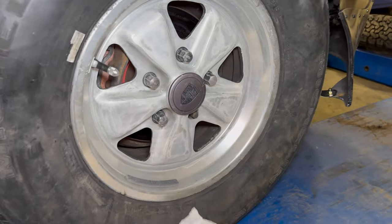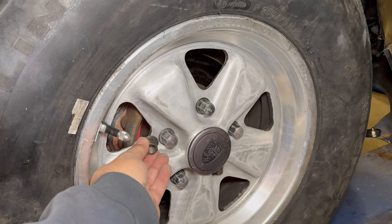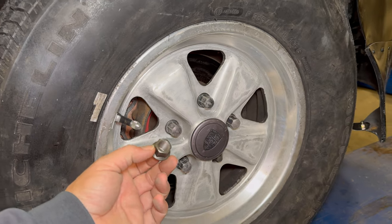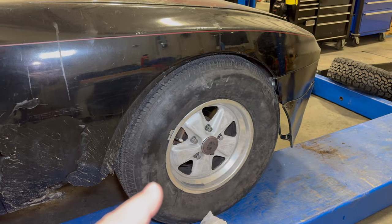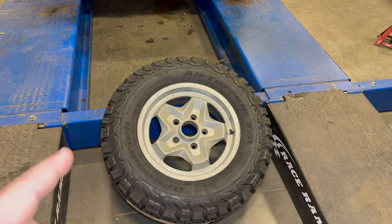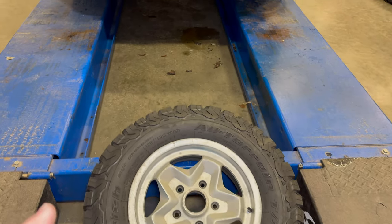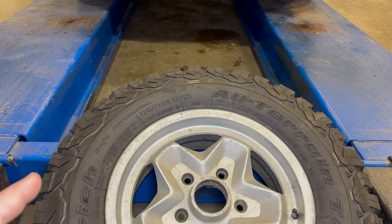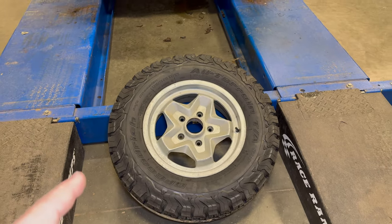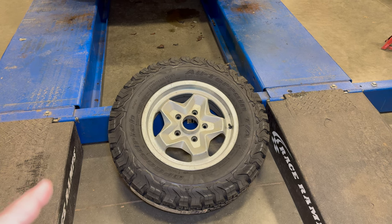So I did buy all new lug nuts. These lug nuts are aluminum, and if you are going to be racing a car it's always good to get lug nuts where you can see the thread engagement — the stud will come through and I'll actually be able to see how much the stud sticks through, and I'll also be able to tell if they ever start to come loose. Because this wheel does not match the rest of the wheels, I ordered another Porsche cookie cutter wheel off eBay and fitted the tires I'm going to be running, which are BF Goodrich All-Terrains — the Baja Champions in 215/75-15. In Europe you might have passenger car tires that fit better, but over here in the US we're basically stuck with truck tires.